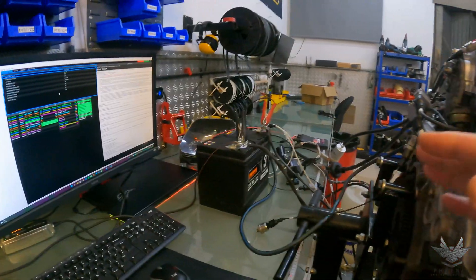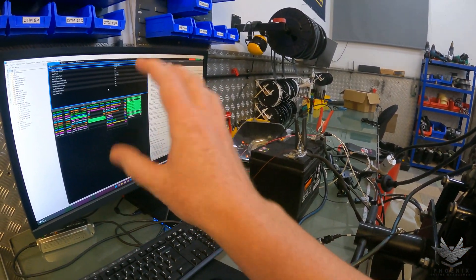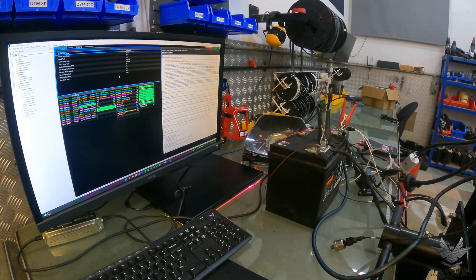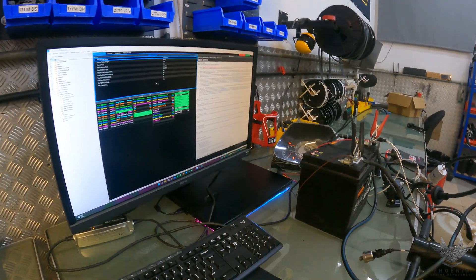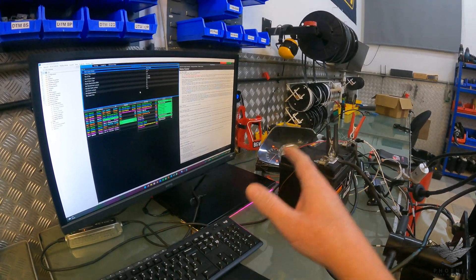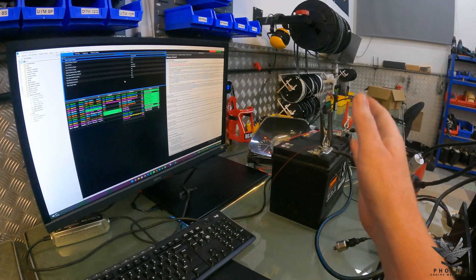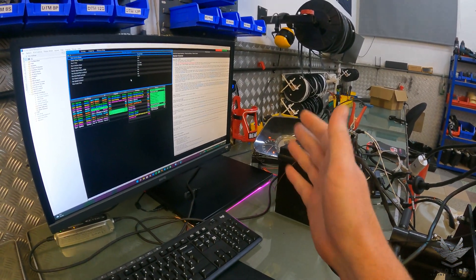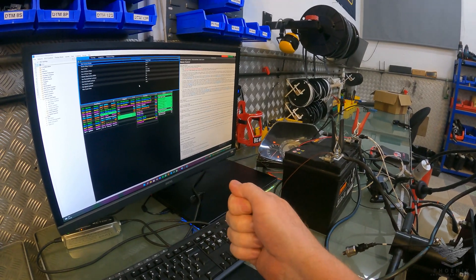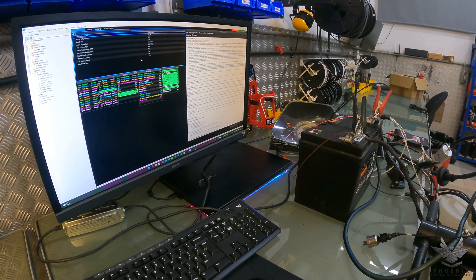Because we're going to be working with the engine, I'm not going to do just a screen grab kind of video, but hopefully with the video you'll be able to see all of the things that I'm looking at. So to start off with — what I mean by starter relay control — effectively the ECU is controlling the starter relay, and therefore it's no longer a system where you would just turn the key and it would then turn over the starter motor.